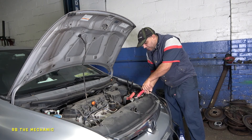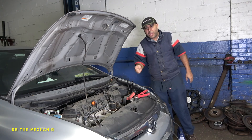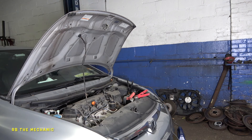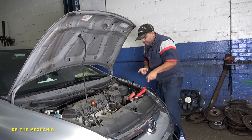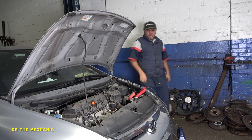One more thing I'm going to do is put a jump box on and give it a try — just in case there's a bad connection or the voltage was low, because this battery looks pretty old. There we have it. Completely bad starter. Give it another attempt. Have somebody move your connections around, because sometimes it could be a bad connection with the jump. One more time — bad starter.